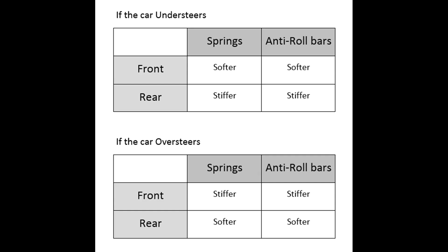To quickly sum up: to correct understeer, go softer at the front — either by spring rates or by anti-roll bars. Both will achieve the same thing, but with springs you also affect the pitching motion of the car under braking, whereas anti-roll bar settings only affect the car in corners. So anti-roll bars are definitely the better thing to change when fixing understeer or oversteer. For oversteer, it's the opposite — soften the rear springs and rear anti-roll bars. One drawback: if you push to extremes with these settings, you can reach a point where one wheel reaches completely zero load. You might have seen front-heavy cars like Civics doing three-wheel cornering with one rear wheel completely off the ground, from going really stiff with the rear suspension.